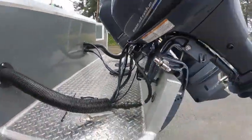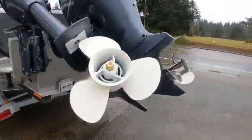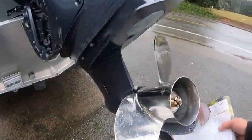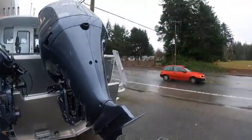If you forgot your drain plug you can get in through there. Don't over-tighten those — just tighten down to where they're hand tight. If you do overtighten you're going to squish the O-ring gasket. We went to a 15 by 15 on the Yamaha saltwater series.